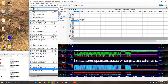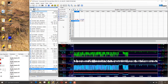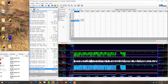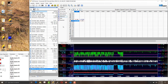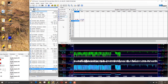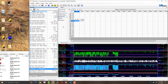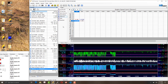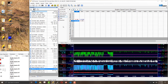I replaced my AEM system — I'll never buy from them again. The sensor didn't work out of the box, and I bought a replacement not realizing AEM modifies the Bosch 4.9 sensor with a trim resistor so you don't need an open-air calibration. I don't like that because you want to be able to calibrate the sensor periodically for reliable data. The AEM sensor ended up being $130 instead of $30 from the parts store.